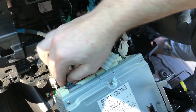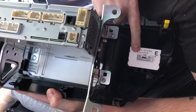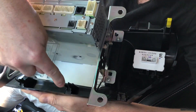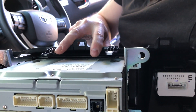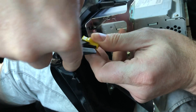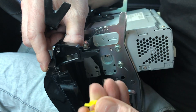That's the old stereo out. There are a couple of things to do with it — we need to retain the seat belt warning light if you have it, which is on the SR and SR5, and we're going to retain all the clips. There are eight clips total — six yellow ones plus two white ones in the center. Use your pry bar under the side of them and flick up, put your hand behind and pull forward. They just pry off and will clip back on the new unit.